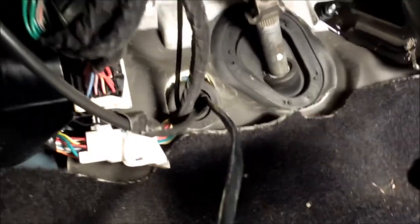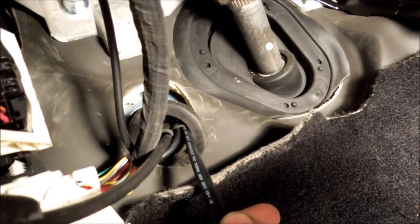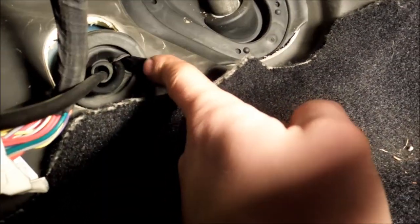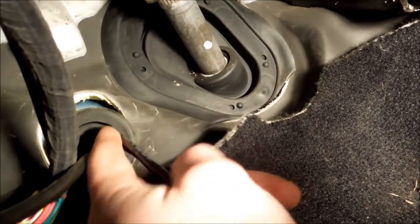It's the one that holds your hood latch, and it's right there. I'm going to show you from inside the vehicle. So if we open the door, I'll grab the light and throw it in underneath — you can see our gas pedals in here. See where I've got the wire coming through here? You can see that small grommet — we went out through there. It's pretty easy. All I did is I pulled it out into the truck, put a little marking, then went through it with a flat blade, and squeezed the wire right into the grommet. Now I can just take it and sink it back in — make sure you push it firmly back in. Now you have wire inside the truck. Another trick: put a zap strap on the wire and you can pull it through the grommet. It makes it a little bit easier.